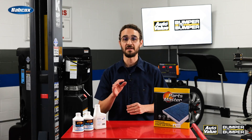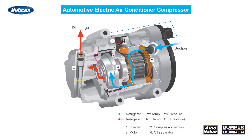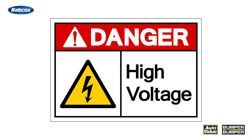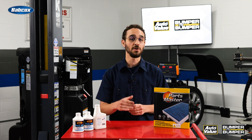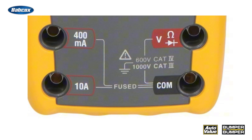What has changed is how we service them. First, let's talk about safety. These compressors can have as much as 400 volts coursing through them to operate, and these high voltage circuits can be identified by the orange wiring routed to them. If replacement of a compressor is required, always follow the manufacturer's procedures to shut down the high voltage source. These procedures will always require the usage of HV Class 0 1000-volt gloves along with a leather glove on top to protect the gloves from damage. A Category 3 rated multimeter is also required to safely verify that the high voltage components being serviced are no longer live circuits.